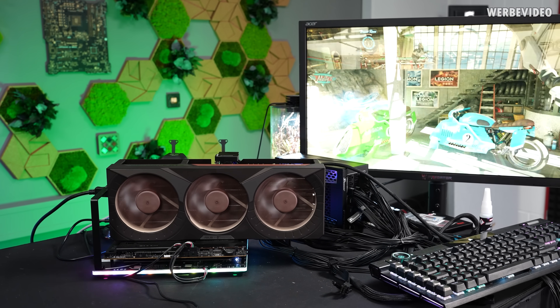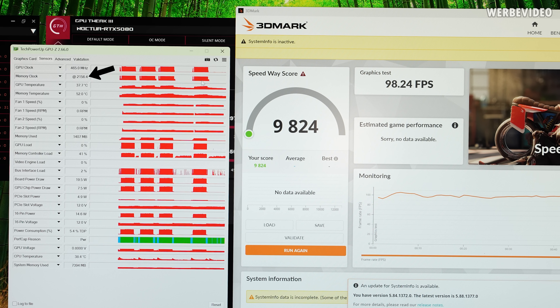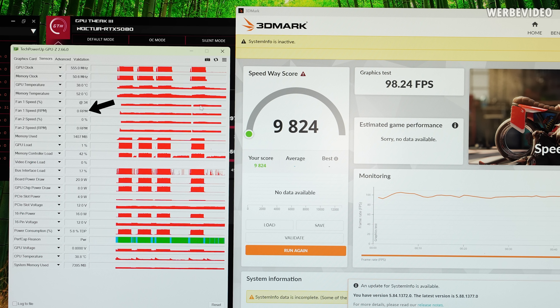Now I'm checking what's possible on the GPU clock. Interestingly it seems to also max out whatever I could set in GPU Tweak, and after three passes it seems stable. With everything maxed out we see 98 fps — about a 10% performance increase — with 3130 to 3150 MHz on the GPU and 2150 on the memory. The GPU stays cool at about 65 to 66 degrees Celsius under load, with the fan speed still at around 600 RPM. That is a really good result.